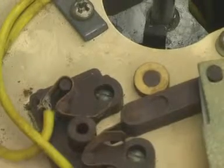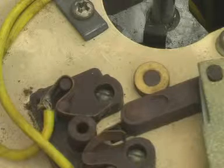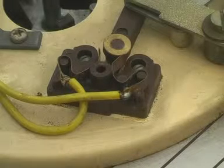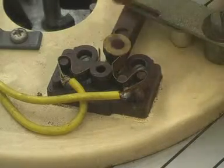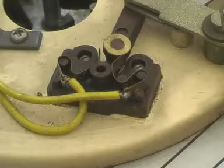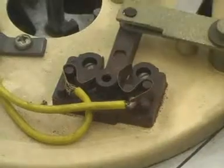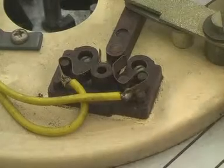Probably Collaro had some of them left over from the 1930s and decided to use them up — this sort of switch is just not really on today. Here it is from another angle: the little brass or alloy cylinder there, which joins these two leaves, is actually incredibly tarnished, which is why it isn't working, and as I say it has just dropped off. I think that is a cue for us to just bypass this switch and forget about it.